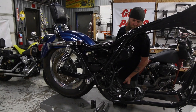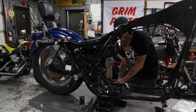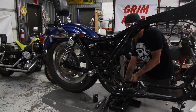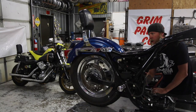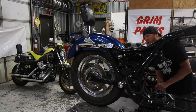Alright, first things first — you want to get the bike up on a center stand. These flat jacks are great for that. The backside of the FXR is a good place to get a flat spot to jack it up on. Once you get the shocks off, go ahead and jack the bike up to get to the inner fender bolts. Just make it easier on yourself.